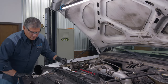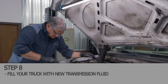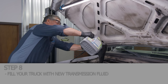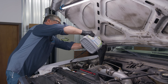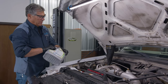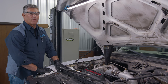We just got our truck back down on the ground from changing our transmission filter. Let's go ahead and get the fluid back in it. We'll start out with two gallons, start it up, warm it up, and then recheck it to make sure it's got enough. I'm going to get my hands cleaned up before I get in the customer's truck. We'll start it up, let it warm up for a few minutes, and recheck the fluids.